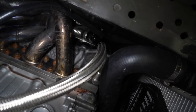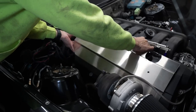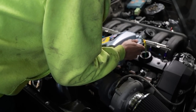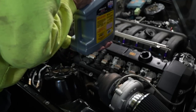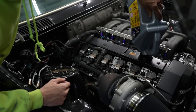It looks really good. This means a lot to me because this thing was leaking like crazy. I can add some oil now. Now that the turbo drain line is made, I'm going to take the cover off the valve cover and take all the spark plugs out. I'm doing a compression test first and then a leak down test after — I want to have a before number just in case any issues arise. I'm filling it with more of the break-in oil. M50s take 6 quarts, so that's what I'm putting in — I always used to put 7 in since M52s take 7.